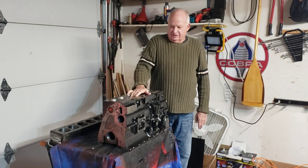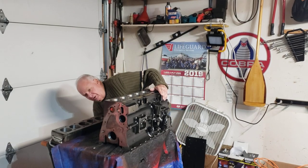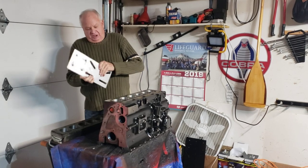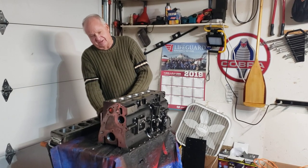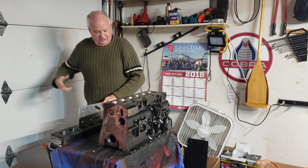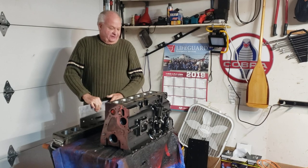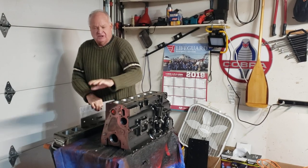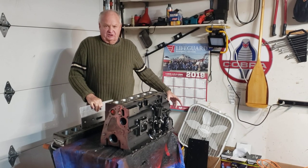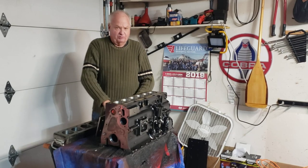So this machine is about ready to install. Also I've developed a mounting bracket, 3-inch steel, which goes on this side of the block so that I can hook my engine stand to the side and rotate the engine this way, so I have full access to the front of the engine and the back of the engine. Instead of the engine stand going to the back of the block, now it goes to the side. It's a little more effective.